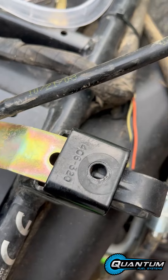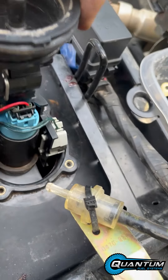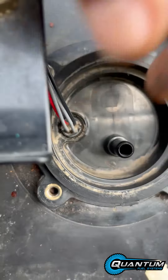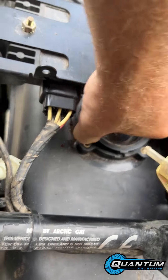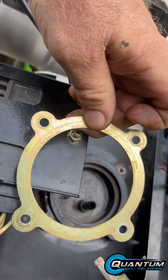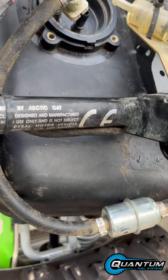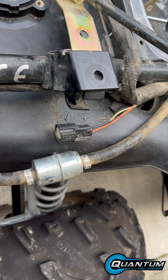Make sure you don't forget your o-ring that goes right here. Drop it in. Make sure your float is pointing that way, towards the left-hand side of the machine. Make sure you line these little tabs up right here and over here, push it down, make sure you've got a good seal, and then put the retaining cover back on. Plug your electrical component back in, and you should be good to go. Make sure you change this filter right here as well.